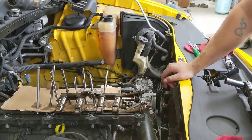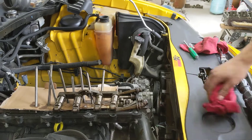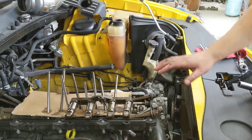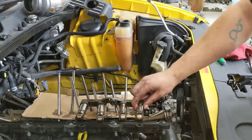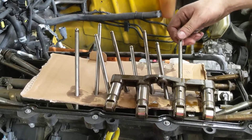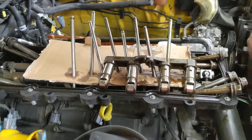We cranked it over, and cylinder number three had a consistent misfire, even though it had new plugs and coils. So while cranking it over, we could see that that cylinder three rocker was not moving whatsoever. And as far as these overhead valve engines go, there's nothing else that can cause that — that cam lobe has got to be gone. These do not collapse; you can't compress these lifters and these push rods. The chances of them bending to the point where the valve doesn't open at all is pretty slim. You will see bent push rods every once in a while, especially with the high-performance engines. But in this case, with a lot of these Chrysler and Dodge engines, it ends up just being the roller fails.